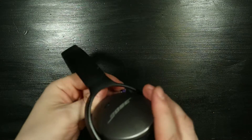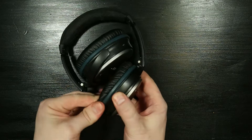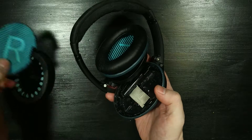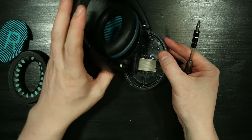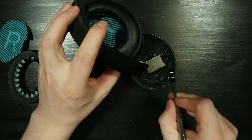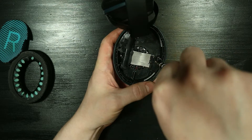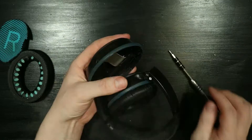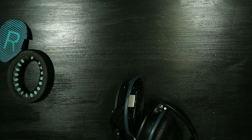To disassemble, we'll first take out the battery if you have any inside, and then we'll start by removing the earmuffs. Once the earmuffs and the textile protector have been removed, we then need to remove two screws. Once those screws are removed, we can remove the metal protector on the outside. You may be able to remove it just with your hands; if not, use a spudger and lightly lift from the side and it should come off.